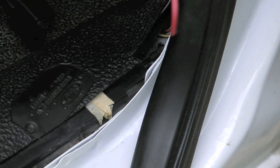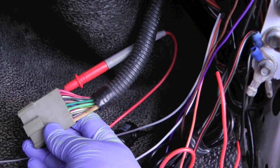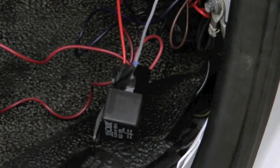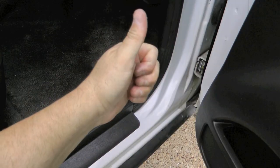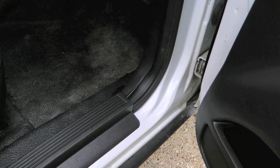As soon as I tap this one into the accessory power — put my accessory there on the pink — you should be able to hear the relay click. And with the relay clicked, we have fog lights. I heat shrunk all the hot connections and went ahead and taped that off as one extra layer of protection. We'll tuck that back up in there, put all the trim pieces on, and call this done. Appreciate it — thumbs up, subscribe if you're not already subscribed, and please tell your friends about my channel. Thank you very much.